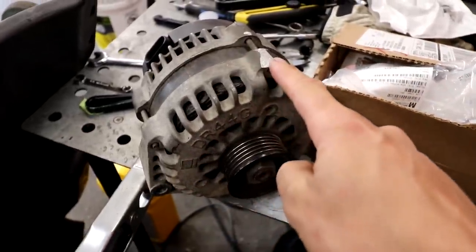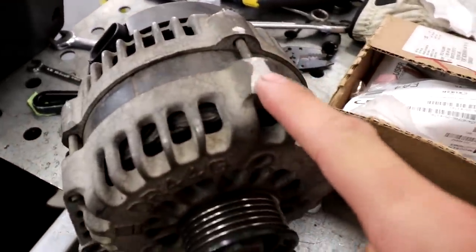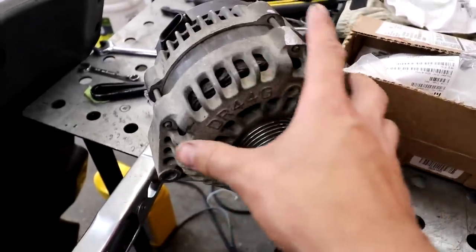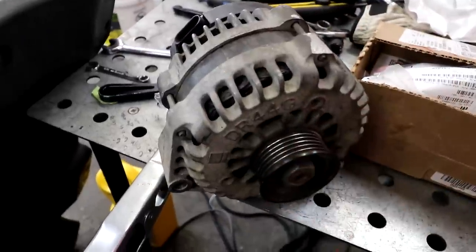I also stole Smokey with the Chicken Slayer's alternator because you can tell that's where it self-clearanced itself on the hood. This one's been modified internally so it regulates itself at like 14.5 volts, which my other one only does 13.5 — a whole more volt. I don't know what that's going to do, but a whole more volt sounds much more better.